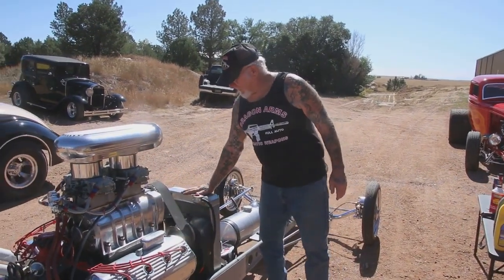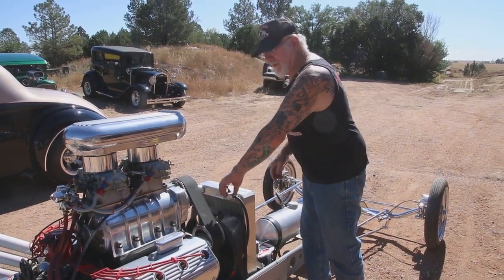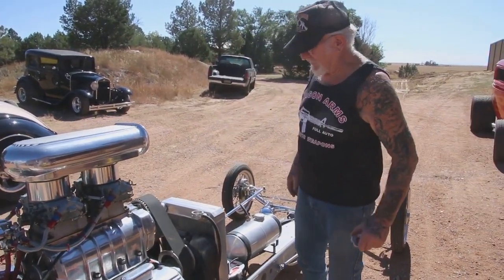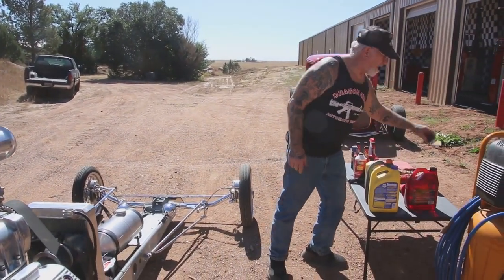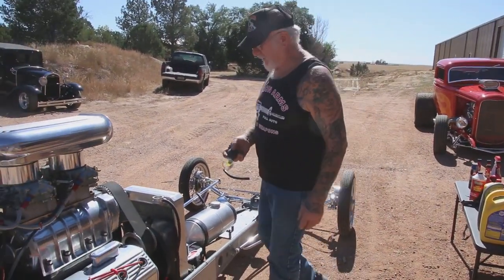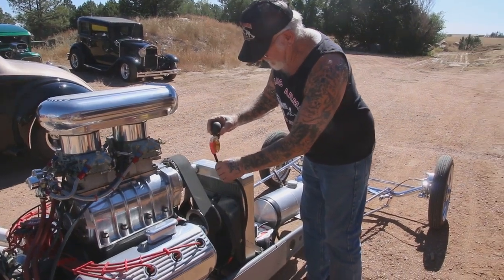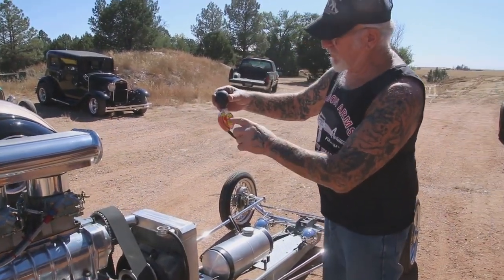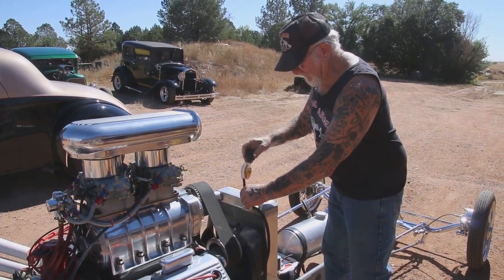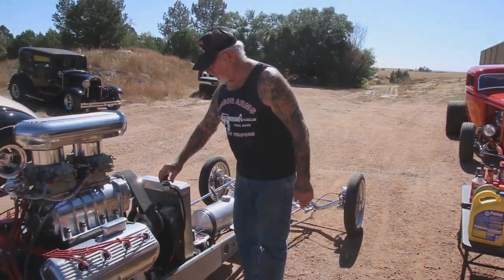So anyway, I thought I'd show you how to winterize a vehicle. First, make sure your radiator isn't hot before you take the cap off — if it's hot, the antifreeze and water will blow right in your face. First thing we're going to do is use the hydrometer. That measures how cold the antifreeze will withstand. We put it in here, get a little sample, and see — it's good for 30 below zero. We're all set. As you can see, it's orange antifreeze, and I'll tell you in a second why we use orange.